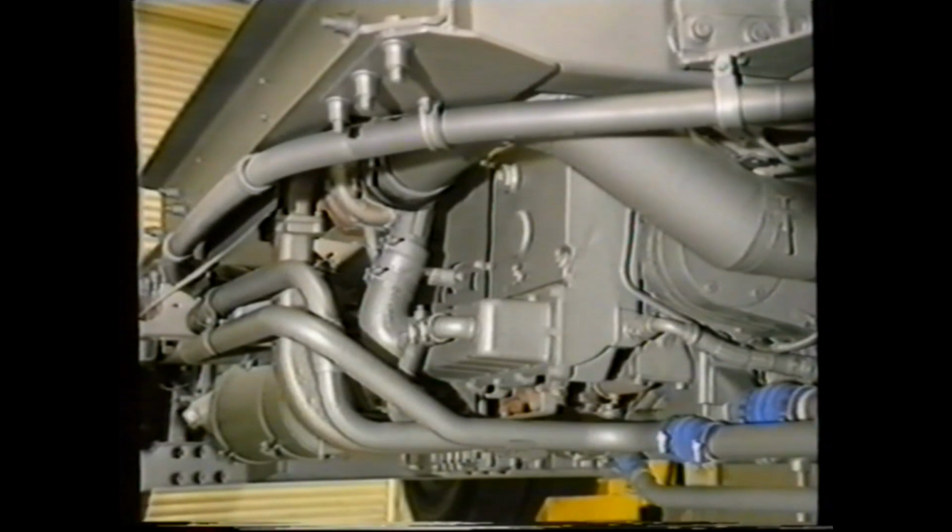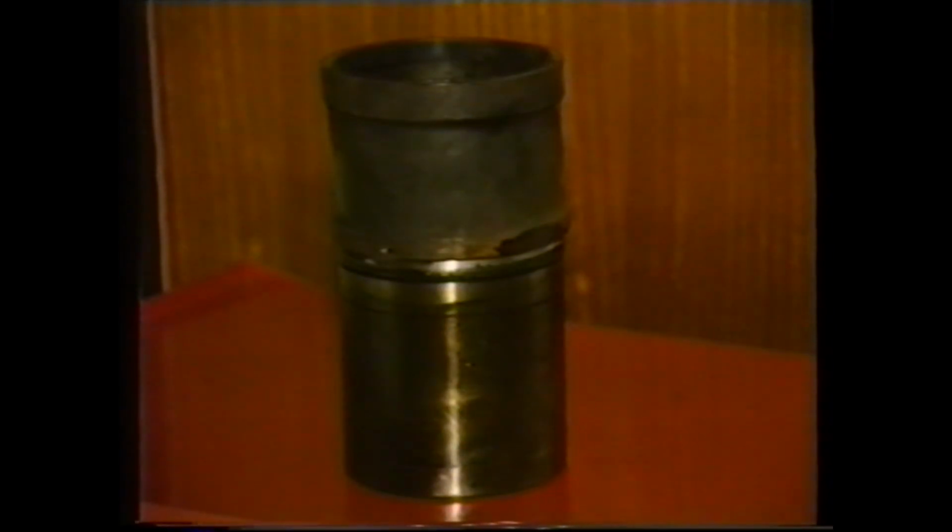One of the areas which is particularly at risk is the cylinder liner walls. The cylinder liners on the L10 are in direct contact with the cooling water and are known as wet liners. During normal running, due to vibrations from the liner walls, unless water additive is in the cooling system, the liners will erode badly and in severe cases will allow water into the engine. Here is an example of this problem.